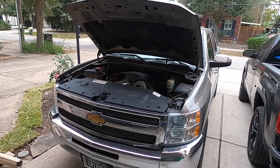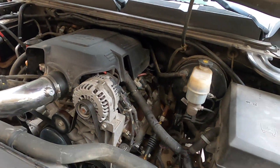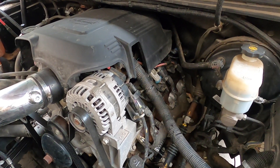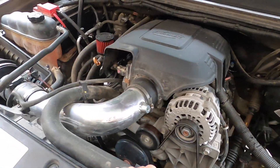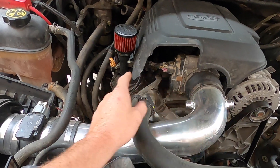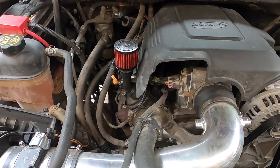We got a little maintenance issue to take care of that I didn't take care of when I did the cam swap, and that is the push rods. When I was doing the cam swap I had to pull the rocker arms and the push rods. When I was putting them back in, I noticed that the ends — the ball end of the push rod that contacts the rocker arm — was kind of worn. These over here seem to be fine, but these are a little worn, so I was a little concerned that maybe there's an oiling issue, and there quite possibly could be.